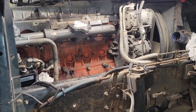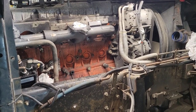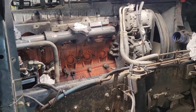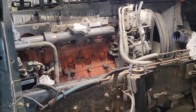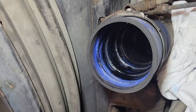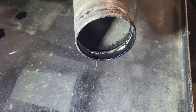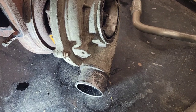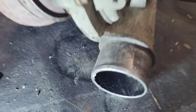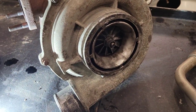I'm doing a bunch of work on this Isuzu 7.8 liter — air compressor, exhaust manifold and a few other things. When I was pulling the manifold apart and removed the turbo, I noticed that there's a bunch of oil on the intake, a bunch of oil going into the intercooler, the pipe going from the turbo to the intercooler, and the outlet of the turbo as well as the inlet.